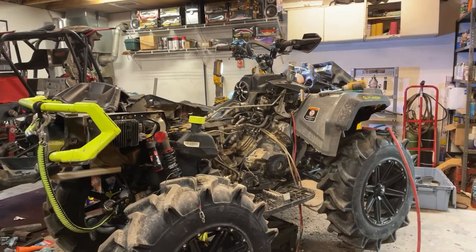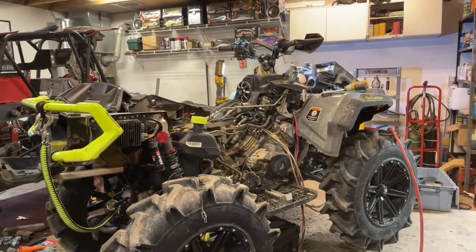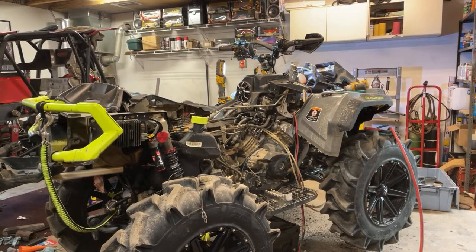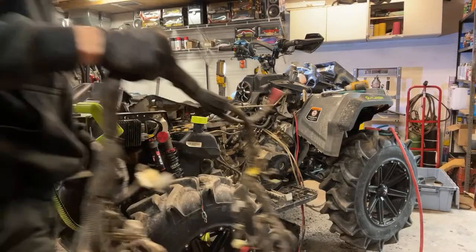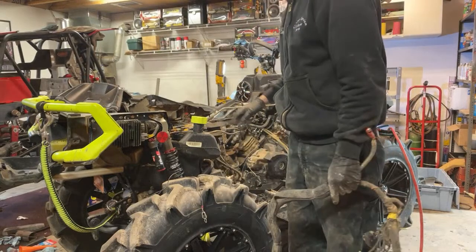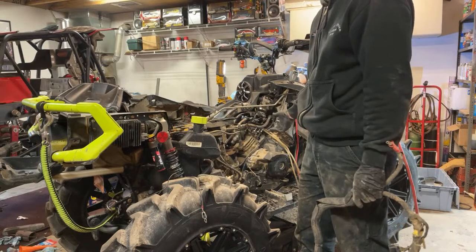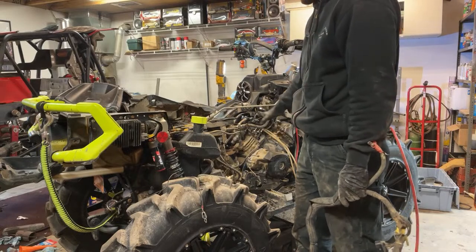What's up, Marshall? I noticed you have the aluminum valve covers. You recommend swapping the plastic ones out for those, or should I wait until? It doesn't hurt if you're going to go in. Usually when your quad's breaking in, you have to go in and readjust the valve lash. Usually a dealer does that. If you choose to do it yourself, it's a perfect time to upgrade.